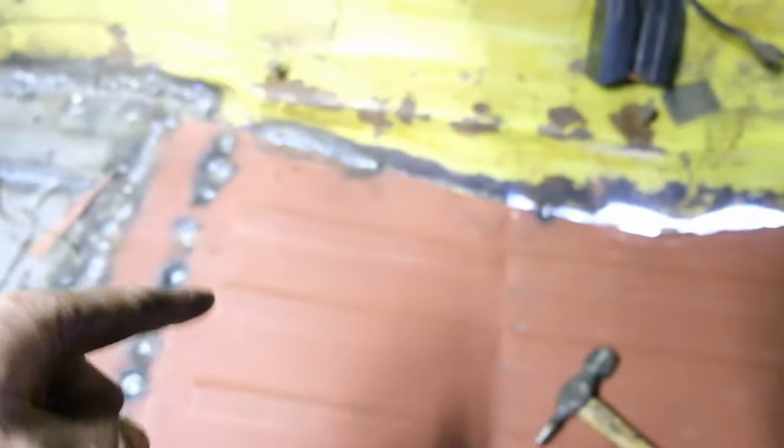I've got a few plug welds on that side of the floor pan, so I'm doing it edge by edge — I don't want one edge to pop up. Now that corner's in, I'm going to work along this edge and start welding. I've already done a bit of seam there, quite nice and neat. These red floor pans actually seem like higher quality metal with primer, though I think they were more expensive.